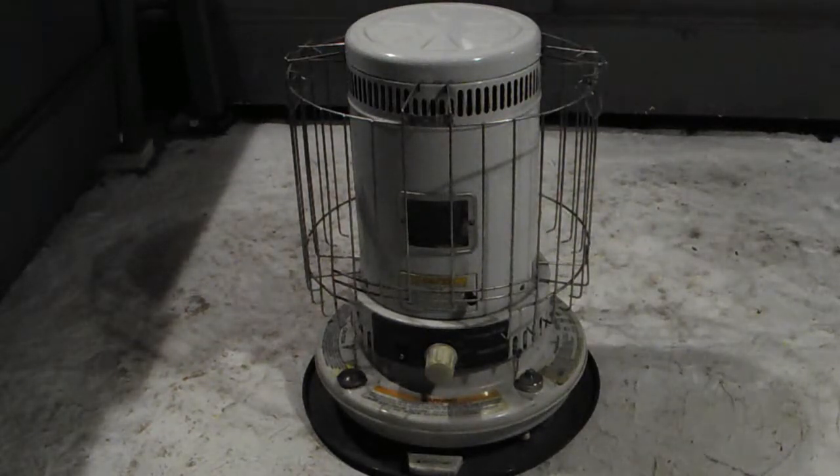When you're looking to buy a round kerosene heater, you really should look for one where the wicks are unpinned. If you buy a unit that is pinned and the wick burns a little crooked and you trim it, you can't turn the wick up any higher because of the pins. If you have just a plain sock wick, you can take the unit apart, pull the wick up, make it level, and continue to run it. The original wick in this unit I burned and raised four times, getting down to the orange reinforcing, and it still burnt just fine.